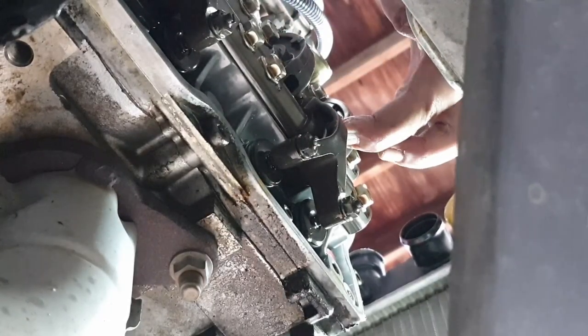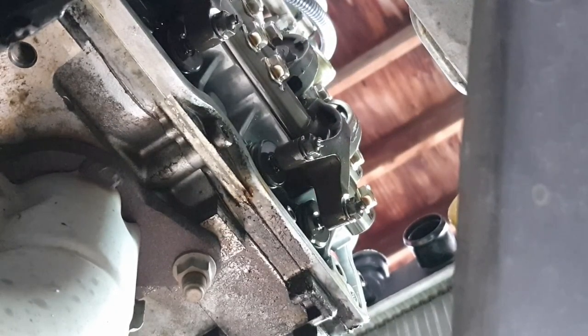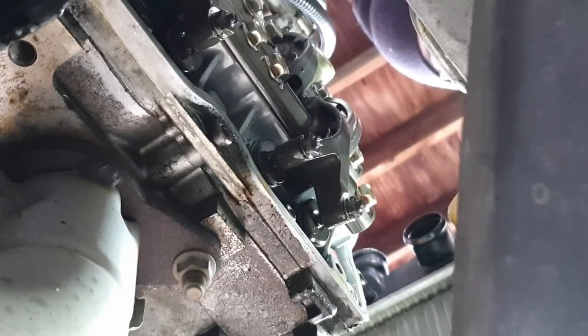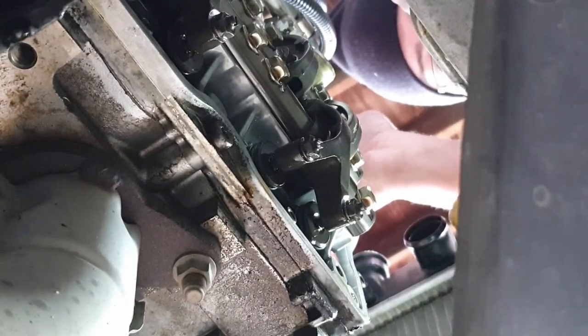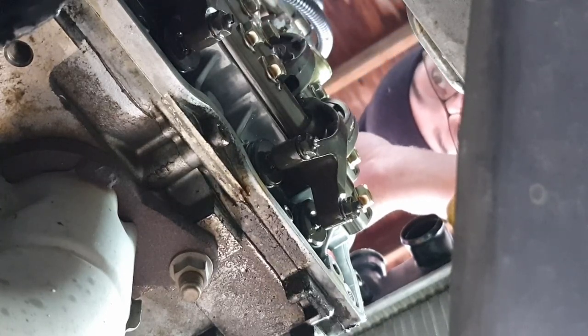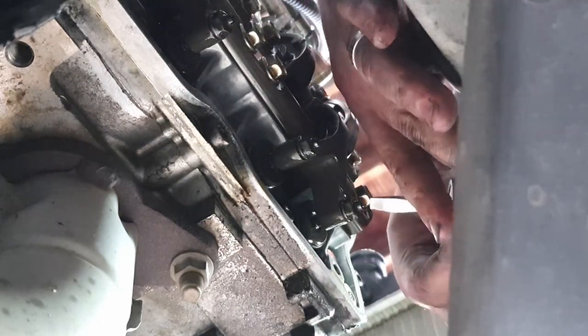The intake doesn't have these shared rocker arms like the exhaust port does. There's a single cam for the exhaust port, and it goes to these two different tappets, I suppose. So we loosen those. Now I have a small flathead screwdriver, which will allow me to adjust these. I'll start with this frontmost valve here on number one. There's 16 valves on this engine, 4 intakes on either side, so 8, and then 8 for the exhaust. What I've done so far is make sure that the rocker arms can wiggle, so they have that slight amount of lash. I've already done the intakes, so I won't even mention those, but I've run down these adjusting screws.